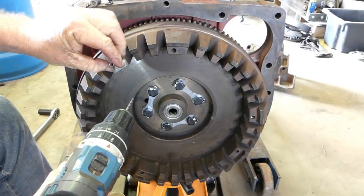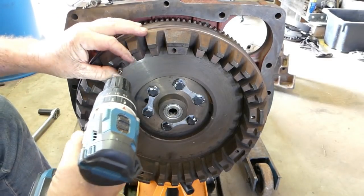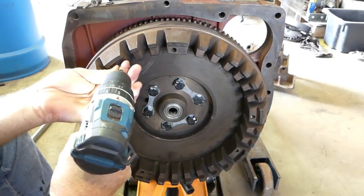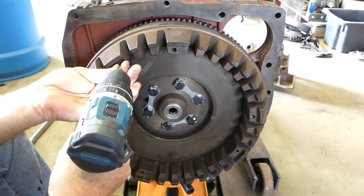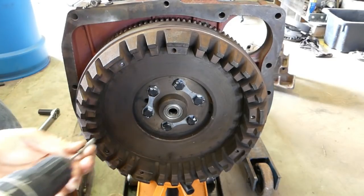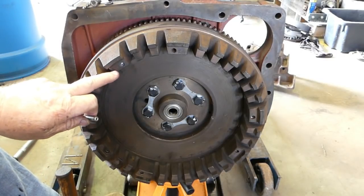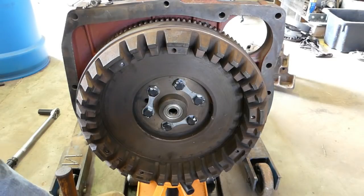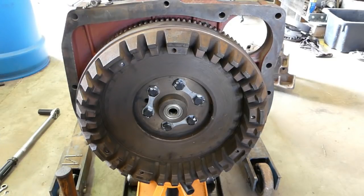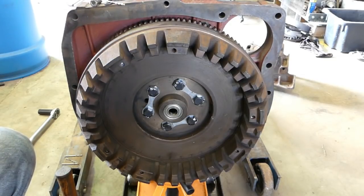So we put the little... Now it's important to make sure it's straight. So what that's done for us up the hole there, that's given us a centre. So we're actually sitting pretty well right on centre. I'll get my head down for a look. Yeah, we're not doing too bad. I haven't drilled in very deep, but now we have a centre and the drill shouldn't run off. We'll just put a left hand in and we'll put a bit of pressure on. I'm hoping that it just bites in and comes out.